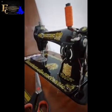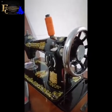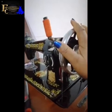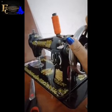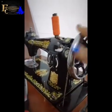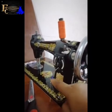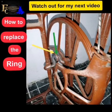It's perfect now. This is the reason why the balance wheel might be moving but the needle itself is static — there is free movement between the balance wheel and the needle. Tightening that ring fixes it. Thanks for watching. In my next video I'm going to show us how to change the ring on the sewing machine, so watch out for that. Thank you.